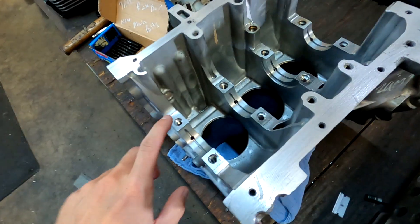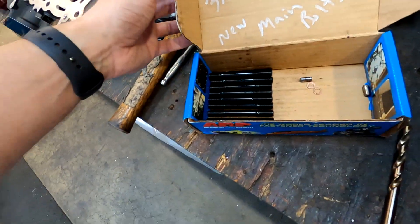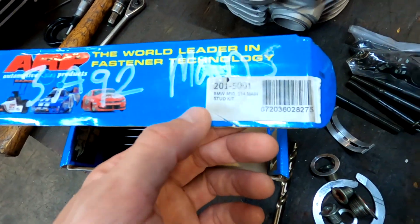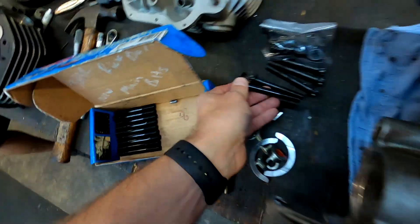Once the crank is back, he'll put it on the balancer and start balancing everything. For today, what we're working on — these are 9mm holes and the main studs I'm using are ARP 10x1.5s, actually out of a BMW application. If any of you are doing the same thing, I'd recommend going to a larger stud instead of the bolts they give you. You can see the length is appropriate and we just need to go a little bit bigger.